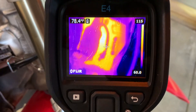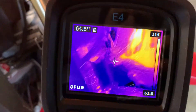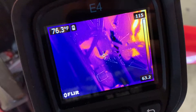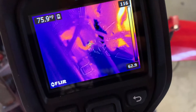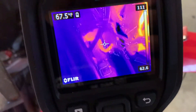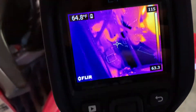What's hot here is the headlight housing — and when I say hot, it's relative — it's 114 degrees. But that wire's not warming up at all. There is one wire feeding this whole area that has warmed up a little bit, but it's 77, 78 degrees. Definitely not hot. It's probably going to continue to just dissipate that level of heat. I doubt it gets any warmer, but I'll keep an eye on it.